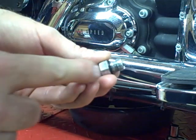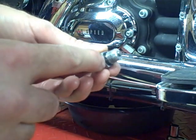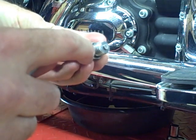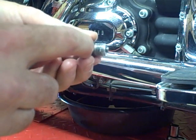After you get your oil drained, you want to take your oil drain plug and check the oil seal — check for any cracks. This oil seal here looks like it's kind of shredded, so I'm going to go ahead and replace it.